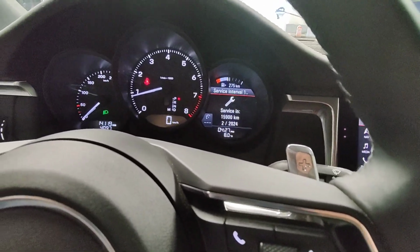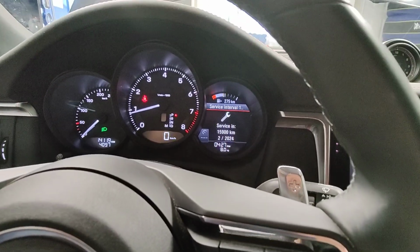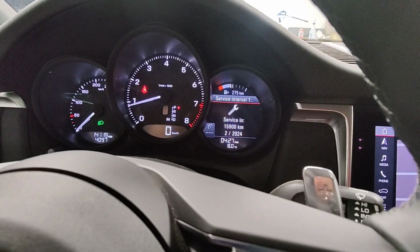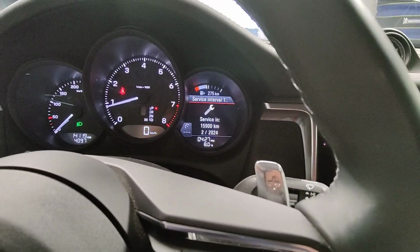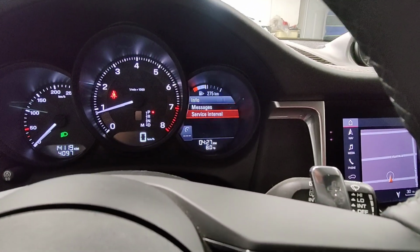I don't have the Autel with me, that's at work. I use that quite often at work for electronic parking brakes and stuff, but I also have a Snap-on Triton D10 scanner that I can use to reset this. So I'm gonna go ahead and put that 1 liter in and then redo the level check.